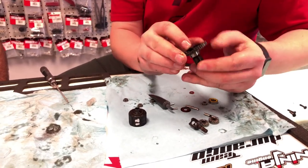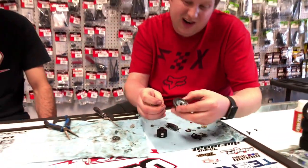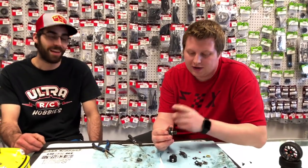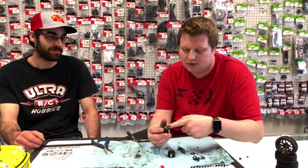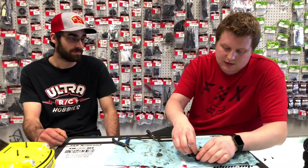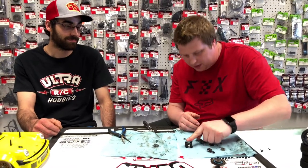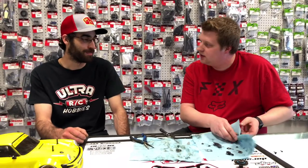A big tip that I always say, which is going to sound really dumb, and people are going to be like, why did you say that? That's kind of a waste of time. Make sure you have a bearing here. You're going to get your diff all together, and then you'll be like, oh, let's throw it in the car. But the problem is now you have to take the out drive out, which in most cases you always forget on the case side. So all the fresh oil you just put in there is going to go for naught because you're going to have to take it all apart. So always make sure you put the bearing on first. Pro tip. I've made that mistake. It's almost like I've made the same mistake multiple times. You learn from making mistakes.